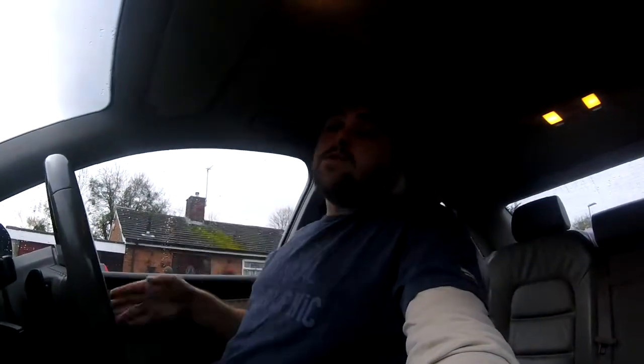So let's get started. The first thing we've got to do is open all the doors, but have them so it shows up as closed and locked — and the boot as well. Because otherwise, once you've opened the door, modules will turn on and you won't get a true reading of how many amps the car is using while it's completely switched off.